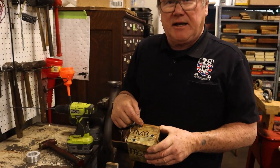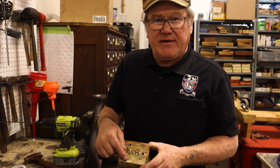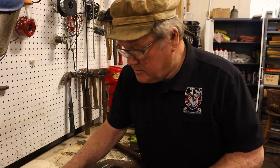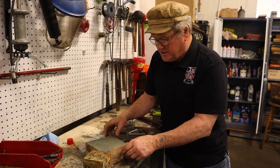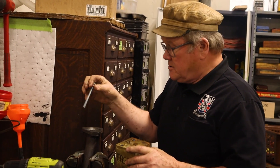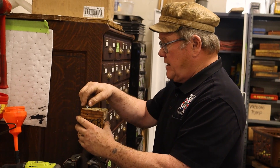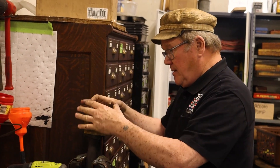The equilateral triangle on an MGB is two and a half inches, center to center. On an MGA it's two and five-eighths — I found that out after I made one for an MGB. So I'm remaking another one here, a little bit bigger. I've already got my pilot holes made here; I've just got to drill it on the drill press and get these guys pressed in. You get the first hole drilled, tap it coarse, put the bolt through, get this lined up, tighten it so it's tight, and then you can drill the other two, keeping the studs all parallel — not off on an angle. Parallel.